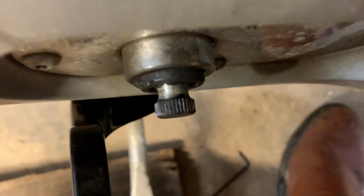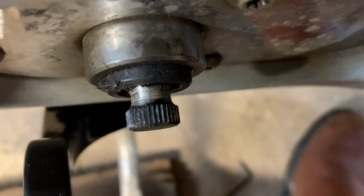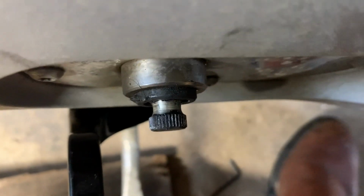Show you one other opportunity we're having. You see that boss down there on the inner primary. You see it touching there. It is holding that lever out when it's slid back that far, which is also, you can see the little shaft. That's the shift shaft. And what's happening is it's not allowing this piece to stick out far enough to get the cover on it.